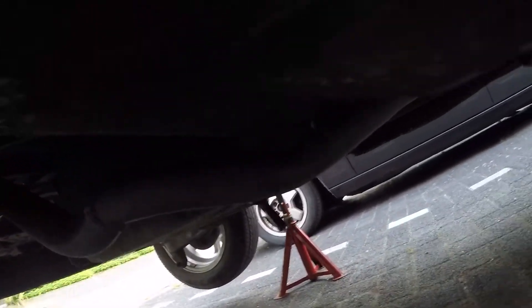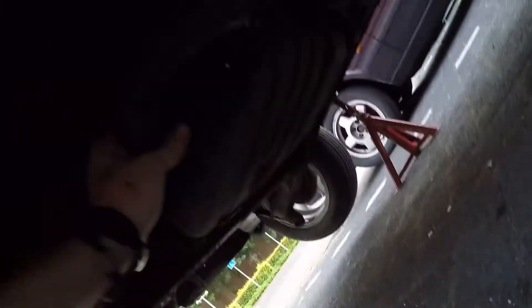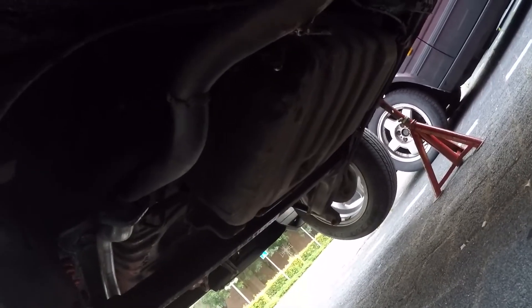Almost OEM. You can barely see anything but the exhaust is on. For the two front bolts I still need to tighten up fully, and then these two that hold the — wait, the ring just came out of there, that's not how it should be. Good that we checked — we're going to put another ring in there. I tacked this one up, the whole exhaust is still warm, but it's all nice and sturdy. The rubbers are good, it's not banging or hitting anything. So it's ready — two bolts here, two bolts there, and done. We can drop it on the floor and listen to the final result of this sort-of straight pipe job.